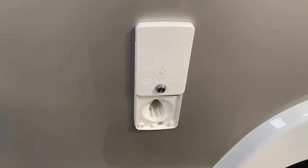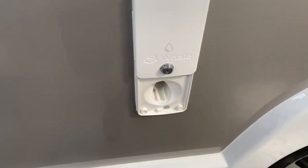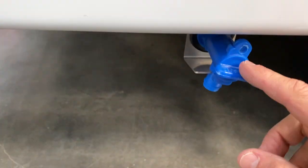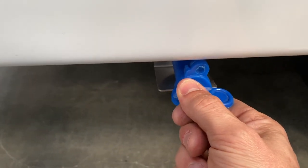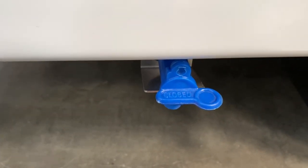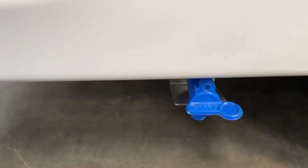To fill up our fresh water, what we need to do firstly is to lift the flap up like so, and then get a hose pipe — the hose pipe clips into here — then turn on our fresh water and it will fill up. Please ensure that this tap here is in the closed position; you'll notice that by the little eyelet at the top being lined up, and this also enables you to put a lock on if you wanted to. When winterizing, please always remember to drain it down by rotating this little knob to the right — that'll open the valve and the fresh water will come out.